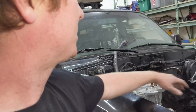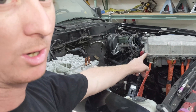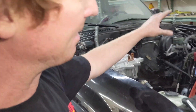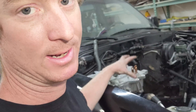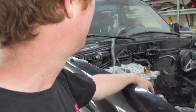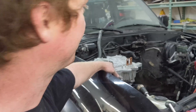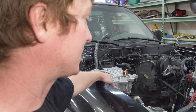The charger is about twice as heavy as the inverter, and that's on the driver's side. So I want to counterbalance that and put the heavy battery over on the passenger side. The main battery pack is going to be at the centerline, but that'll help my weight distribution. So the next project is wiring and the 12-volt system.